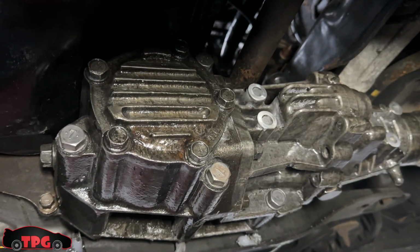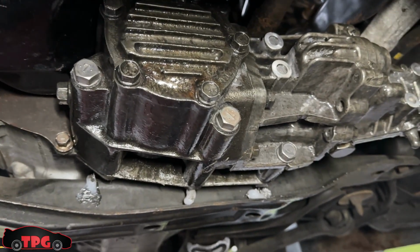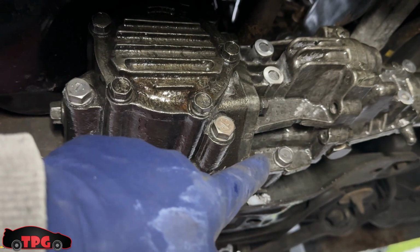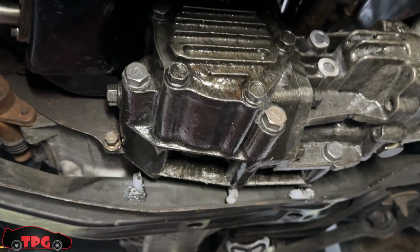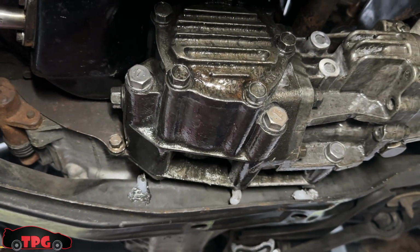Everything's put back together. These bolt holes, once you put those Billet Tools threads in there, those Helicoils, they feel better than the front two right here. That one turns and then locks out. It's done. You can't crank it anymore if you want to. These ones, however, you get them nice and snug. You can still keep going an eighth turn, eighth turn, eighth turn. And that's probably honestly what I did when I was cranking them.